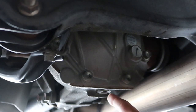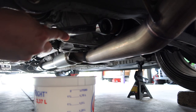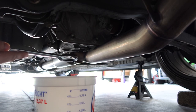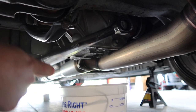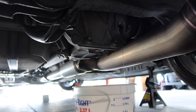With the drain bucket down here, let's see how much fluid we can retrieve. Here is the 24mm wrench — fits nice and snug on the fill plug. We're going to break the fill plug loose before we do the drain plug, that way air flows through there and doesn't burble up, and we get all the fluid out nice and easy. Interesting — we're already getting some pouring out, so I don't know if they overfilled it or what.